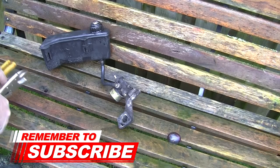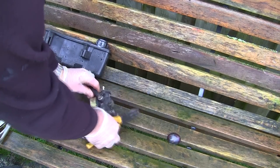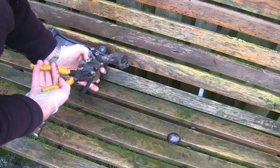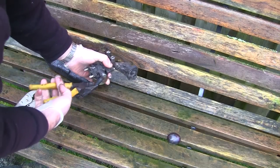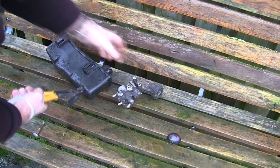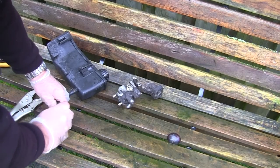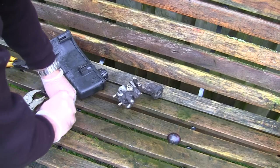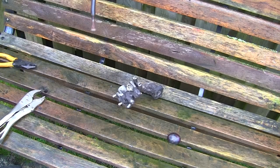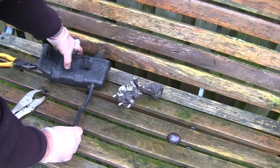I've just got this full thing outside. I think what I'm going to do is remove this fuel line here, take that off there, and get some pliers and grab that. I'm going to slide that down there, and this whole fuel line should just pull off like that. So if I get an old bolt like that as well, screw that in the end, that should save all that fuel from falling out of there as well. And that's not leaking anymore. I can keep that separate, and see how that just stops that leaking out of the bottom of there, that old bolt. I can keep that separate now in the garage, not wasting all that fuel.